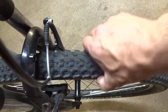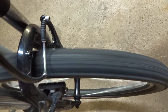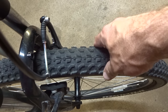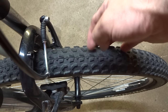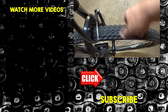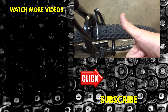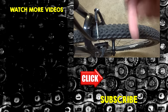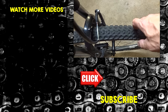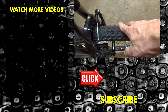I remounted the wheel on the bike. There's no side to side movement at all — it spins nice and smoothly now. And that is how to fix a loose and wobbly front wheel. The rear wheel is basically the same; you might have to remove a freewheel or cassette and there might be some additional spacers, but it's basically the same kind of thing. Hopefully you found this video useful or interesting. If you did, please give it a thumbs up, click subscribe, and click the bell so you get notified when new videos come out. I'm over on Facebook at RJTheBikeGuy. Thank you guys very much for watching.